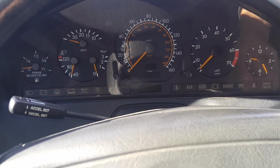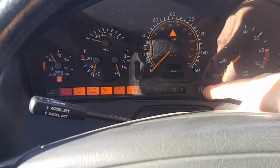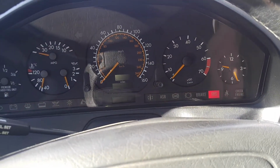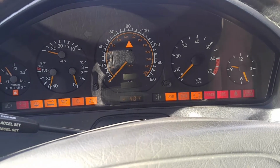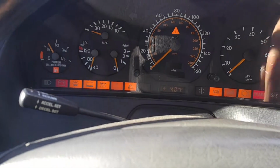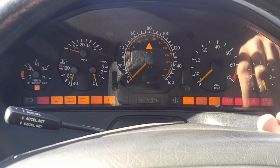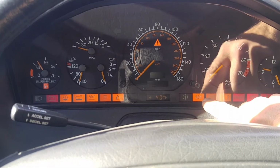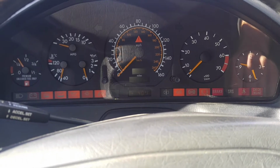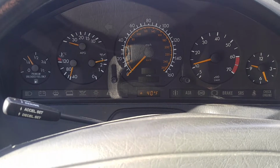Oh yeah, so what I was gonna show, as you can see, now all the lights come on. Well, this bulb is out. I mean, there's something wrong with the suspension, but you see all the lights come on. So before, as you remember, when I put on the ignition, the lights would blink and go out, especially those lights, because of the shorts in the lower harness. So that is very encouraging. And also when you start the car, these lights don't go out right away. They stay, it's a normal procedure. Everything is good. So this is the cold start.